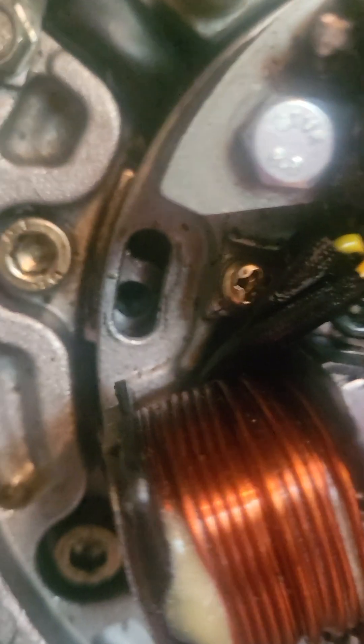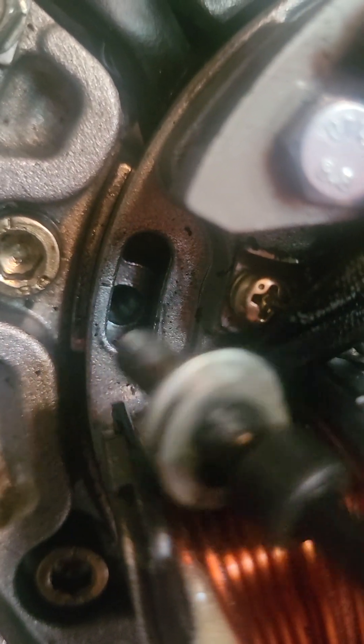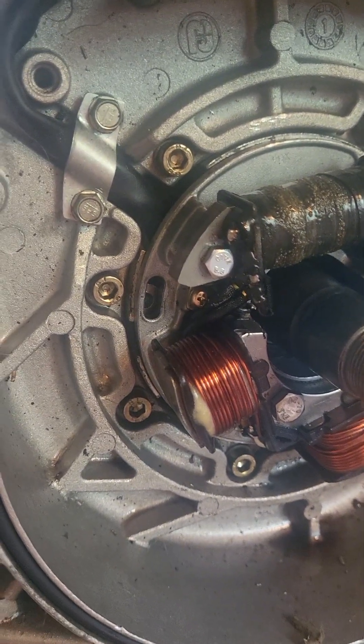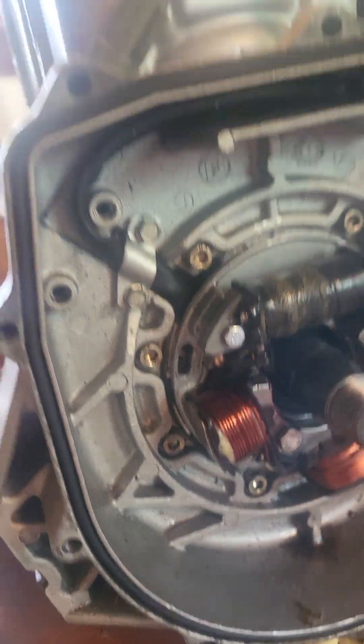What I've found so far is if you look here really close — it's hard to see — see the three lines? If you take that bolt out right there, there's the center line right there. From what people have mentioned on the internet and from what they've said after speaking with SBT, their recommendation is just to align the center of the stator to that center bolt. The alignment holds it.